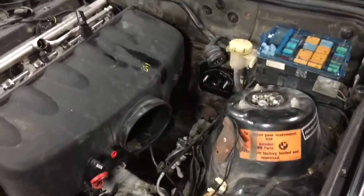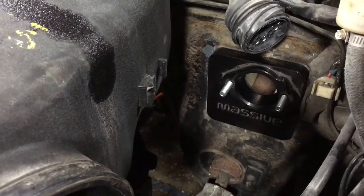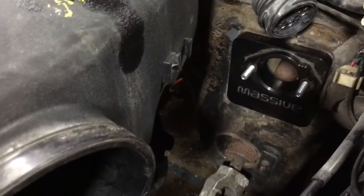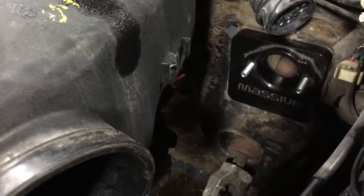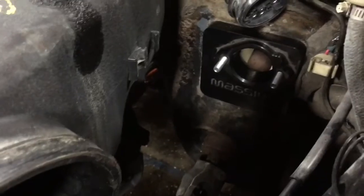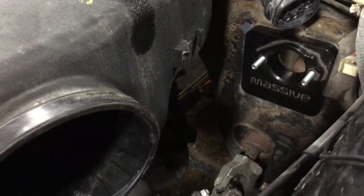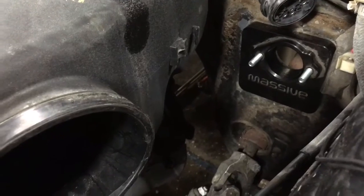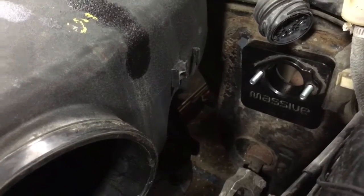As far as the Massive booster delete goes, you generally run a stock E30 master cylinder - any stock E30 master will work. On the other car I've got, it's just a stock 91 M3 master. I have a 91 318iS master I'm going to test fit here since I have one on the shelf that's low miles, but I did buy a brand new 325e master cylinder. The non-ABS one has a nice small bore that works really well for the booster delete, and you can plug the extra holes on it and make it work with an ABS system just fine.